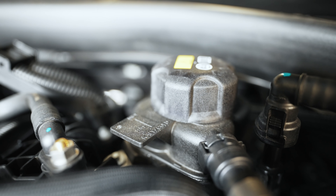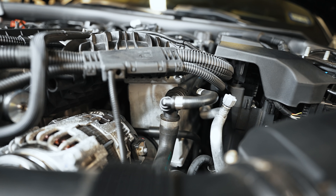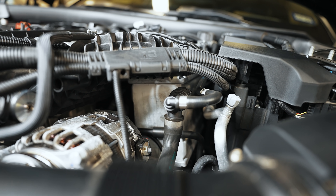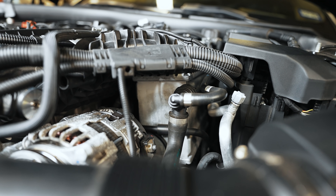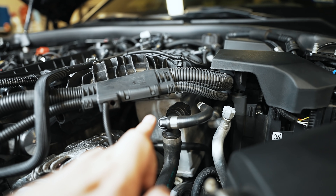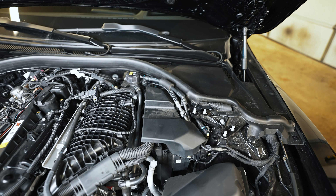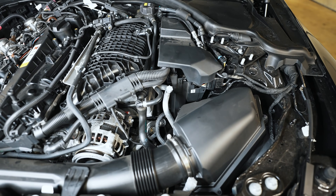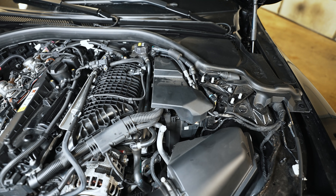Given this car doesn't have a traditional intercooler, that would be your charge air cooler reservoir — there's coolant in there. This is your bleed line leading up to it, and this is your coolant hose that clicks into the charge air cooler. On the M cars you can see the charge air cooler just exposed like that, with the intake manifold bolting to it out in the open. They do that for cooling — to help it radiate heat into the engine bay rather than being completely contained in the intake manifold as it would be on something like a B58.